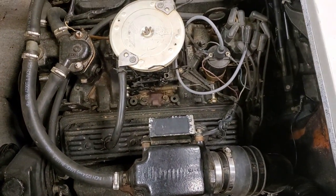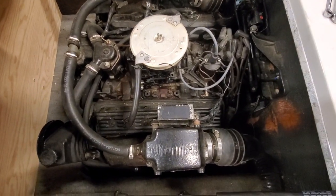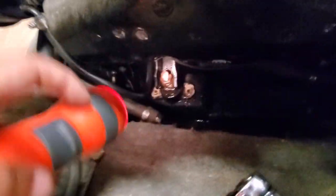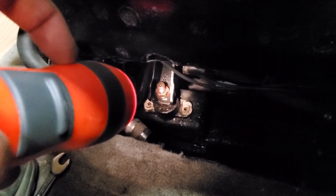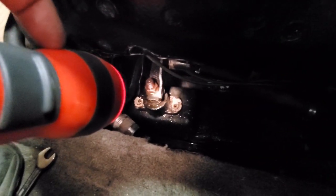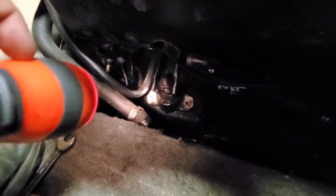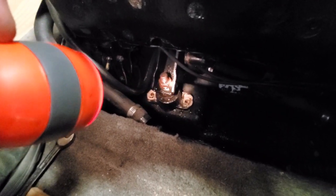On this thing for a couple hours now, and I think we've got everything disconnected, ready to go. The only thing that we really had a problem with is that giant nut there on the motor mount. So we actually pulled out the bolts that attach the mount to the boat. We're gonna have to try and get that all apart once we get it out on the bench somewhere easier to work on it, because you just can't get very good leverage on that nut. But other than that, nuts are out in the back, or the bolts that hold it to the transom drive.